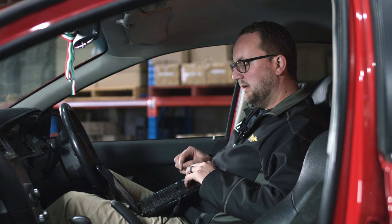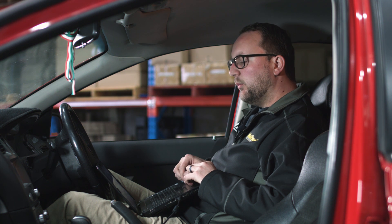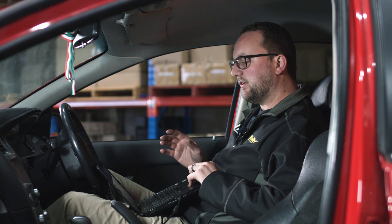Now that we've got the laptop set up, the software on, and we've gone online with the ECU, there are a couple of things we need to do before we try to start the engine. I'm going to go into the main setup page — you'll notice some stuff flashes up red straight away. The first thing: plug-in information. When the units are shipped, they're set to none. Clicking on that red box, it asks: what type of car is this? Is it a Ford Falcon BA 6-cylinder naturally aspirated manual, a turbo model, a ZF model, a BF, an FG — there's a whole bunch. We need to pick what type of model this car is so the ECU can program its CAN language correctly in order to communicate with the car. In this one, I'll come down and say it's a BF, 6-cylinder, turbo, 6-speed automatic.